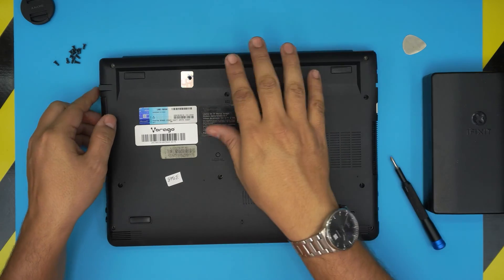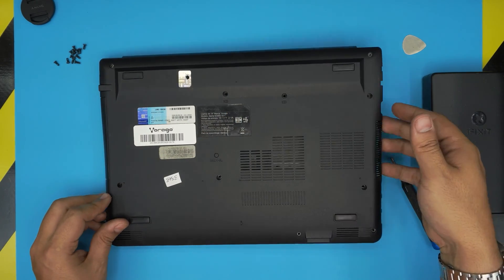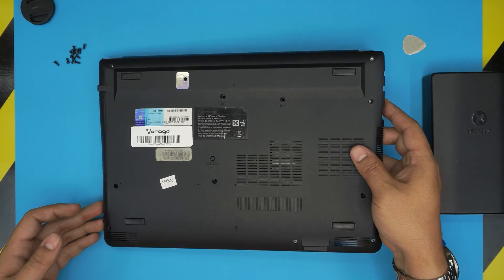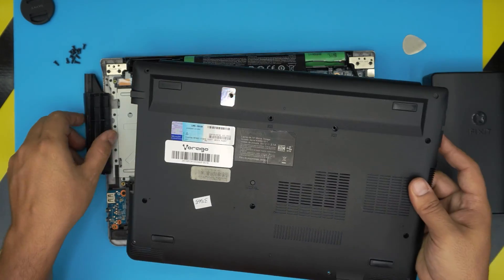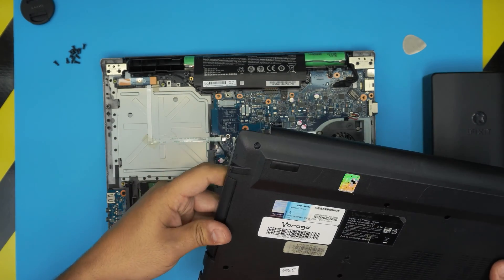Once the right side by the fan and the front end are open, grab the cover, slide it toward the audio jack side a little bit, then lift it up — otherwise you risk ripping the audio jack. The carry face plate just comes out.